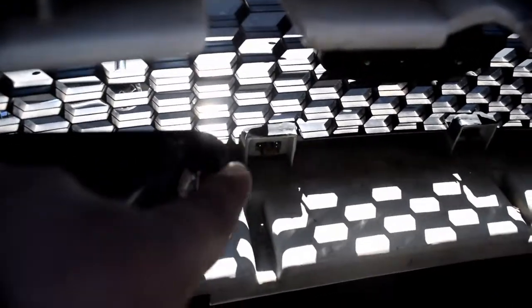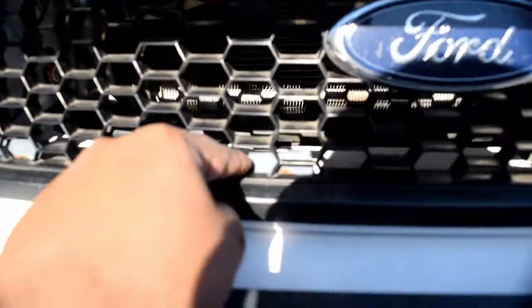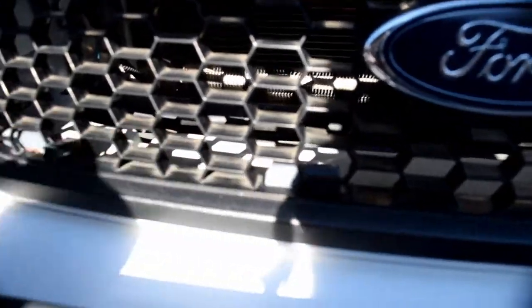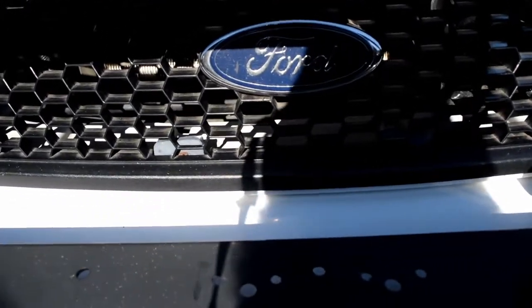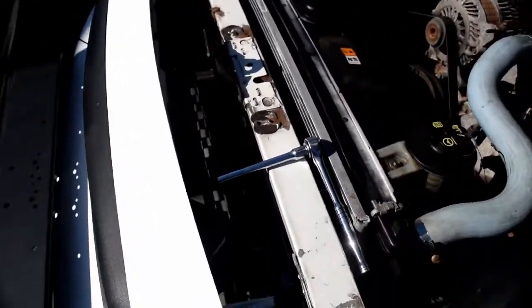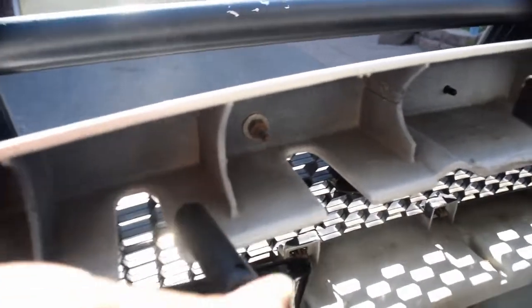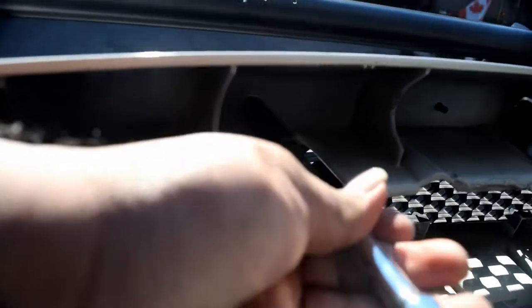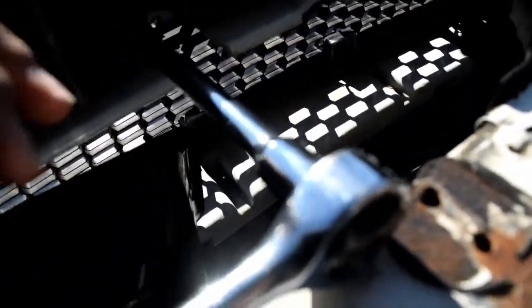When it comes to the bottom, you have four clips — one here, one there, and one on each corner. You can actually see them from the outside of the grill, those things that stick up in your grill on all the P71 ones. The slotted grills hide them a little more but those are the clips holding them in. This is a plastic grill so it is very easy to break — be careful. You really need the deeper sockets and an extension because without one you'll have very little room to work; with an extension it brings it out and you have more than enough room.